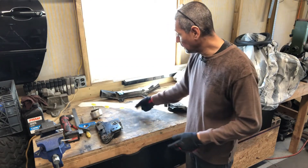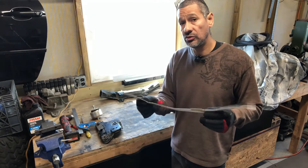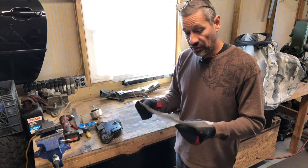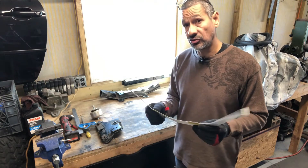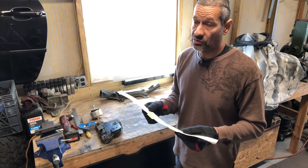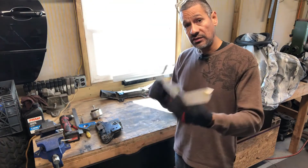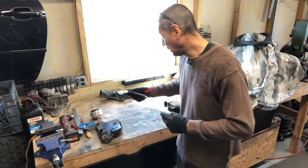Here is the template of my engine — three-quarter two-inch tube that I'm going to use to build and attach this together. This will also attach my steering rack, pushing the steering rack forward of the engine. We've taken the length of the shaft into consideration and hopefully it won't negatively affect steering geometry. It will affect it, but hopefully not badly. We won't get there until the engine is sitting in and the steering rack is attached — that's down the road a bit.